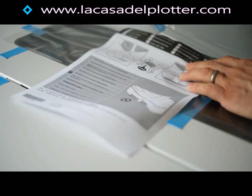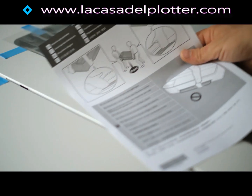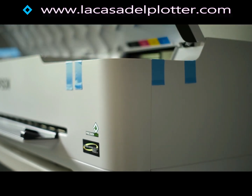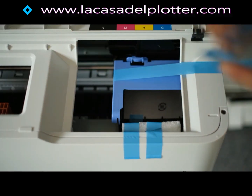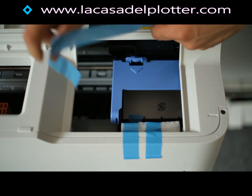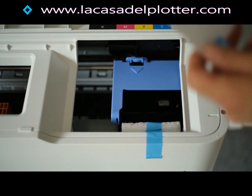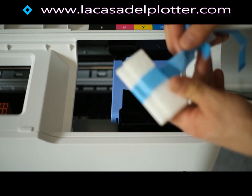Next we can remove this guide that shows you how to lift the printer. Next we want to remove the first piece of tape that holds on the front cover. Then on the right side we can remove this piece of tape which will allow us to open the cover. Then we can remove the tape that is holding the print head in place. And remove the tape that's holding this little styrofoam piece here. You might want to save this if in the future you decide to move your printer.